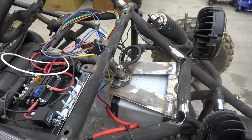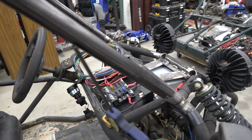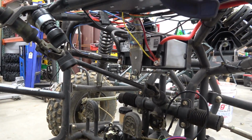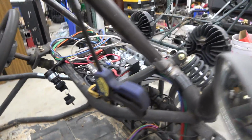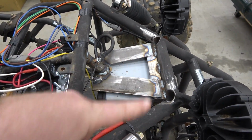So that last clip you saw me building a battery box. Now there's not a lot of room on this since we did dual gas tanks and we have that huge 625. So we're having to come up with a different spot to put our battery. I ended up having to go with a smaller battery and we've located it under the dash. So you can take out a bolt and pull the battery out from inside so we can sheet metal all of this later.